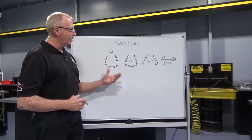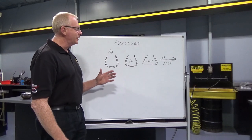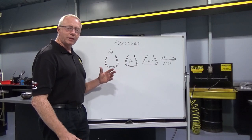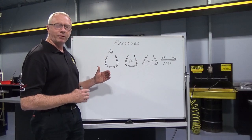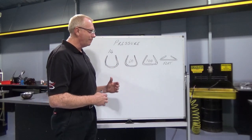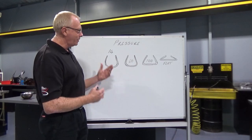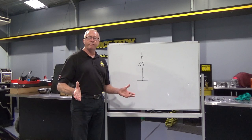It's inconceivable that the ideal shape will be at 14 psi for every rider. Beyond rider weight, we can also look at rider demand — a pro level rider is obviously going to stress his tyre a lot more than a novice, so it's inconceivable they'd have the same tyre pressure. But amazingly, so many people out there are still running that 14 psi.